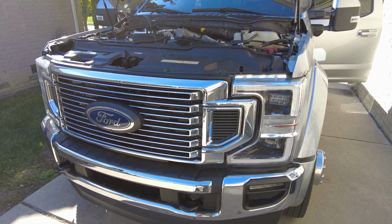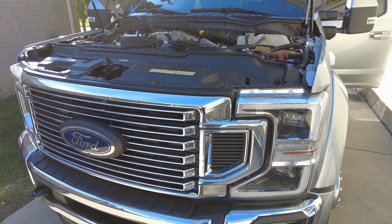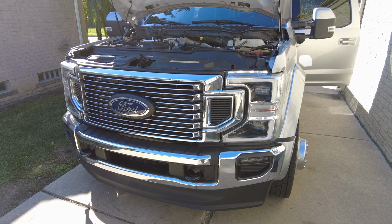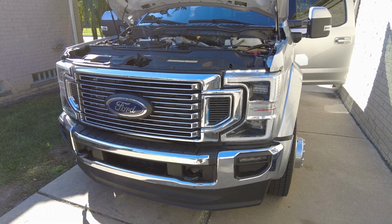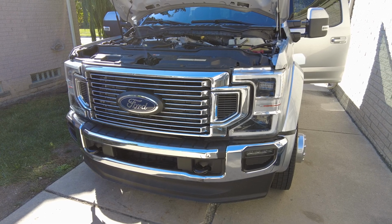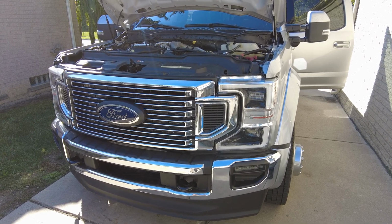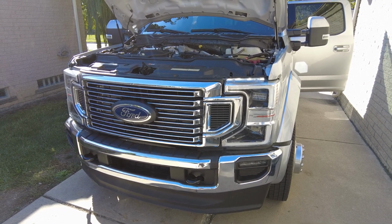But nonetheless, it wouldn't be the worst thing in the world to high idle this thing overnight in an emergency to power your home. Ultimately, the best solution would be a power boost, because it doesn't even really run the whole time when you have a power boost. It has the ability to turn on and turn off based on the available power in the battery, and then they give you that big hybrid battery that will hold the power output for a good while. With that power boost, I even ran that compressor that I showed you earlier, and it didn't even kick on most of the time. It just ran off the battery.